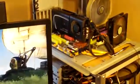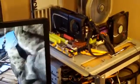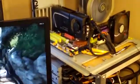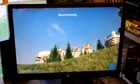We're almost at 75°C, which is nothing to worry about. Once you hit about 85 to 90, then you need to start worrying. But I basically think it has a lot to do with the fan speed only being at 55% right now. So like I said, he's running in a case, and not the best scenario. It's on the floor, between his desk and the wall and whatnot. So his temperatures are probably a good amount higher, and I told him to test it out, but he couldn't figure out how to run the MSI Afterburner, which is no big deal.